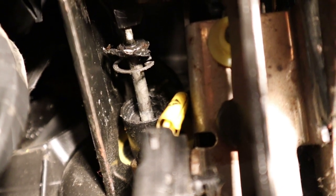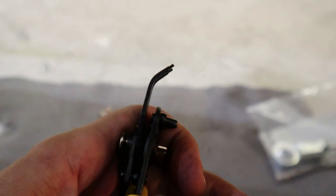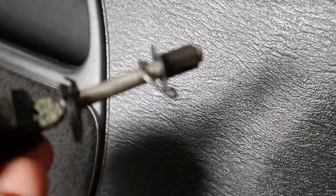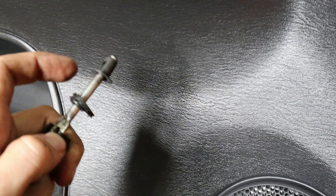Quick update: I've got the snap ring and the dust boot off. The snap ring has been murder. Something that might help you — the clutch pedal is obviously disconnected, I did depress that to get in there. There's a connector right here that I disconnected for the time being. This is the snap ring plier I used — got it on Amazon, I'll leave a link in the description. You want the head with the little bend on it. A long time later, I finally got the stock arm out.